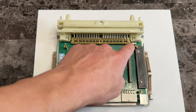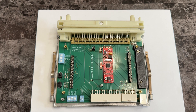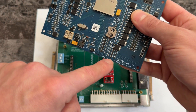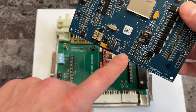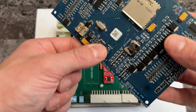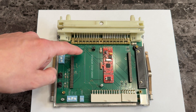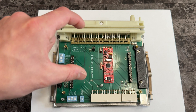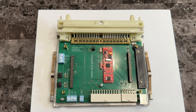I also added some fuses — a fuse for the MS3 Pro module and a fuse for the wideband, just cleaning things up. For this module: this is the version 1.0 MS3 Pro module, and there's a version 2.0 module I've shown a few times before. It has some extra ADCs that they're going to be adding support for in the firmware soon. Eventually I'll have a little harness for extra ADCs and inputs from the main board. I also want to add extra ADCs to this module — so you could use it for extra ADCs or for full support for the AW5042LE stock TCU.